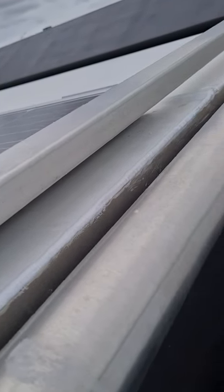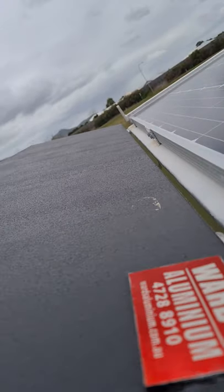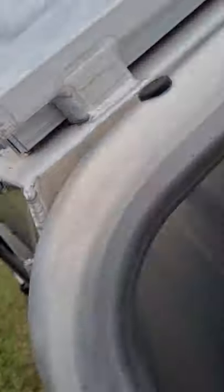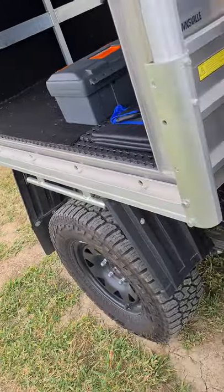The only thing I painted black is the doors. Black's probably not the best option up here in North Queensland with the heat, but with the insulation it's not too bad, and with the colour of the car I didn't have much choice anyway. The finish is etch primer and then two coats of Raptor Liner — very scratch resistant, really good.